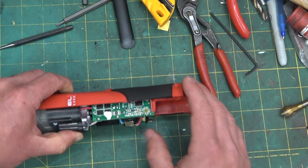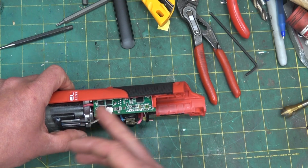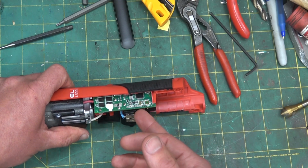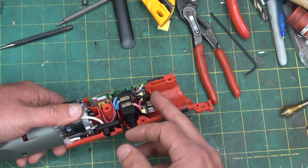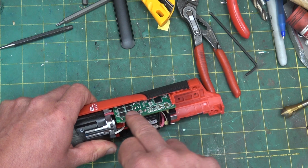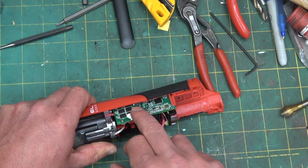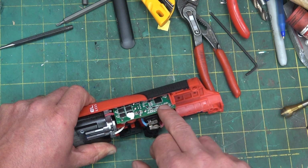What's going to blast out of her, of course, is the brain box, or the silicon. You're running a few amps through here at max torque, the thing's going to get hot. There is some heat sinking on the backside through the vias. These are the MOSFETs that actually do the switching. You can see them paired up here for each of the 3 phases in the motor.